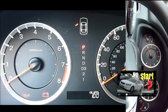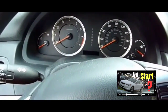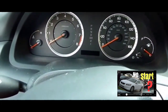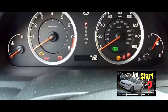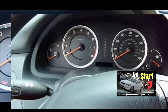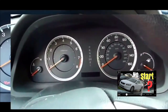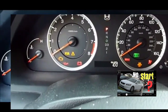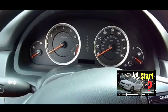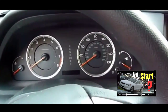Now, in a rare case, I could have had an alternator that was going out and I drove on a dead alternator all the way to my house and the battery just died on the spot as I parked it. But here's the thing about it. I checked my headlights, and the beams are strong. My high beam is strong. I'm pretty sure it's not the alternator. It could either be an absolutely dead battery, or the starter that's just dead, which is unfortunate considering I don't think I put any more than about 25,000 miles on the starter before it died on me.